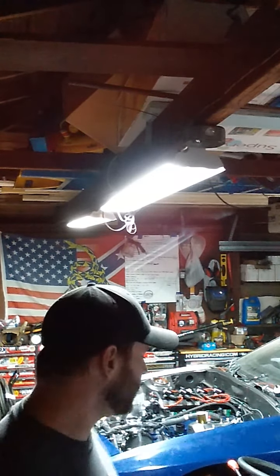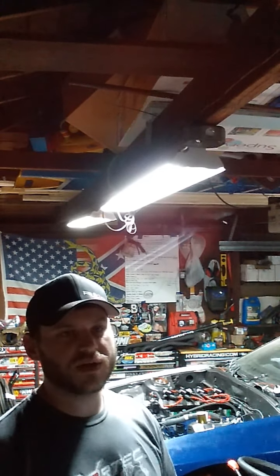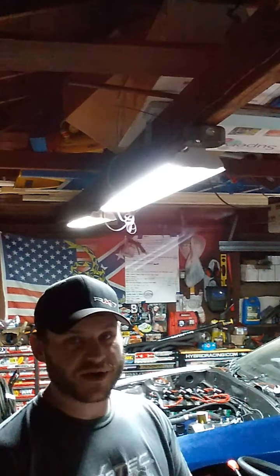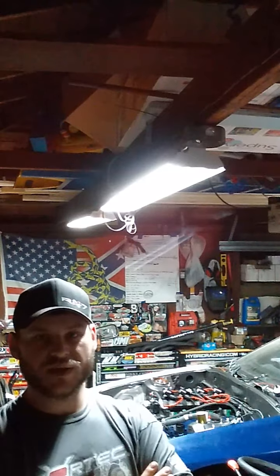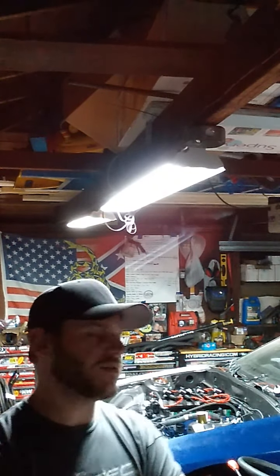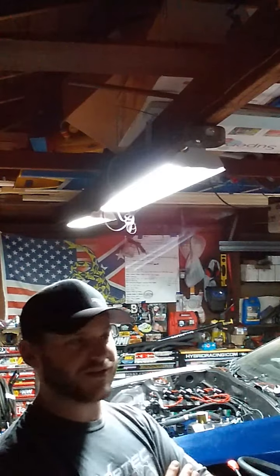One of the things on my list over there on the wall was to weld the V-band clamps onto the headers. As I said yesterday, I am going to be taking on making my own exhaust system, and one of the things I wanted to do was put V-band clamps on, just to have ease of removal next time I have to pull the trans to do a clutch or what have you. I didn't want obviously a solid, one-piece exhaust from the headers to the muffler with no way to separate it if you need to work on something or service something.